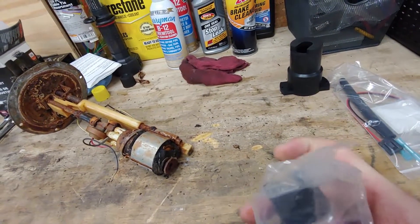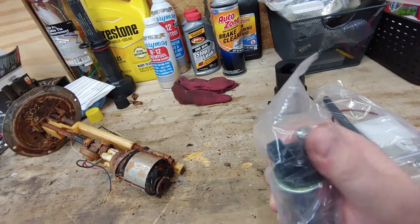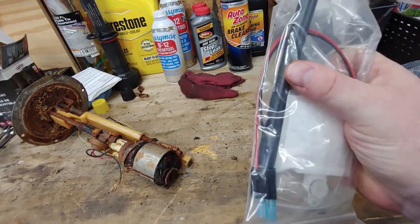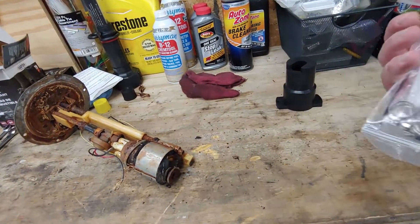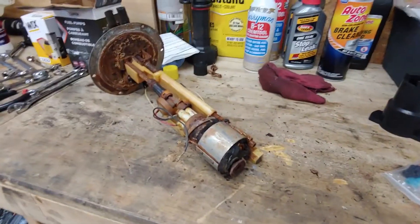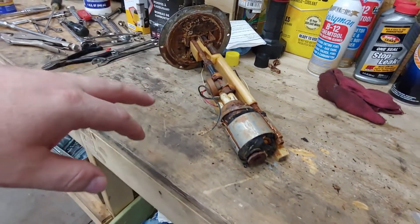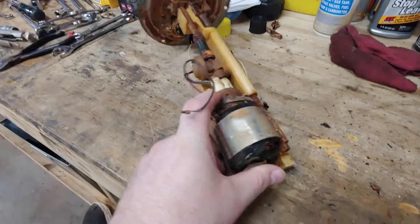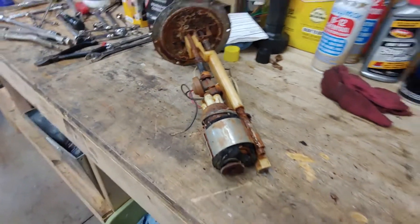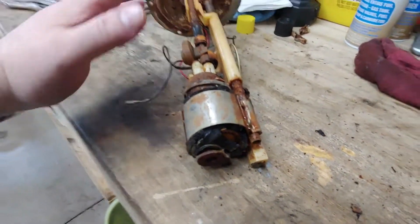Looking at it, I guess I could take it out of the container. There's two little connectors, a little spade connector, and then you got this guy for the hose. Here you got your connector, your hose, some little heat-shrink swage things, couple hose clamps, a filter, and this looks like some kind of mounting stuff. If you look over here it's not very different — here's the hose. Everything's disgusting, so this is all about to get cleaned up. This started out as that, and that's old fuel — this new fuel is terrible. When I got the truck the tank was full, and it stunk and it was yellow — it was not good, it was varnished already. This is why this all looks like this. I don't know how long the truck was sitting. The guy I bought it from only had it for like two weeks, so he really couldn't verify either.